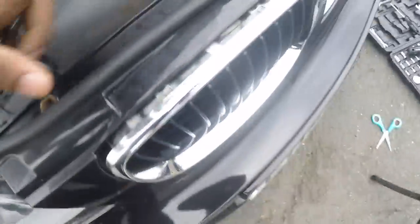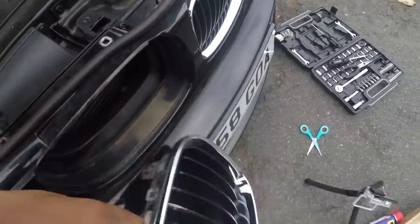The hardest part is actually getting the bottom bits out. For the bottom you need to get your flat-head screwdriver onto the point at that edge and then push it down — as you push it down it'll just come loose. Then you'll be able to pop it out. Just do that for both sides at the bottom and you can essentially take the grille out like this — there we go.